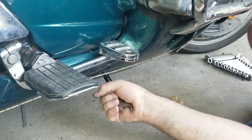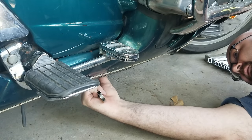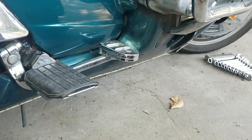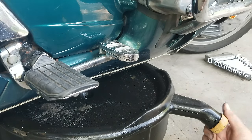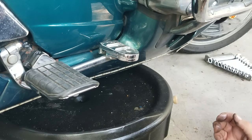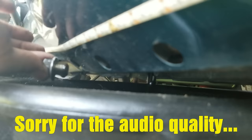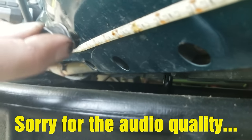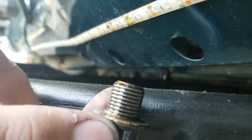This thing is being stubborn — definitely a hard plug. I'm going to have to tap it. With a little persuasion it finally comes loose. Before it fully comes off, let's put the pan underneath there. I'm going to take the oil filler cap off so it can vent and set it to the side. There we go — took the plug off and didn't even get a drop.